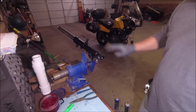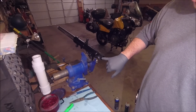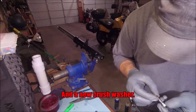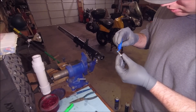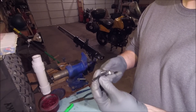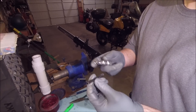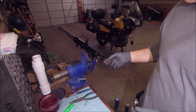So that's only going to be put in there temporarily — we still have to put the oil in. Now we're going to torque down this bolt. First, we'll take it out and put some Loctite on it. I didn't have an Allen key hooked up to a socket, so I found an extra one and cut it off — it's a 6mm. Then use a 6mm socket on there to get in and torque this down.